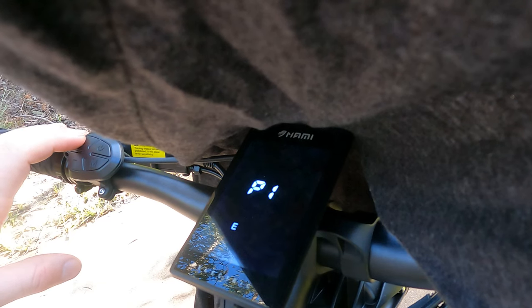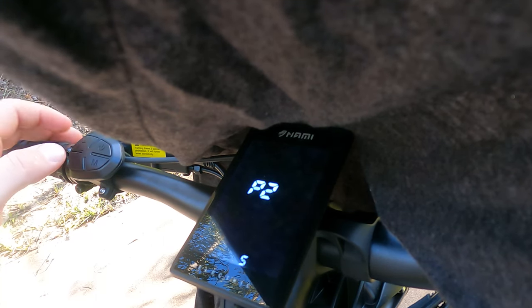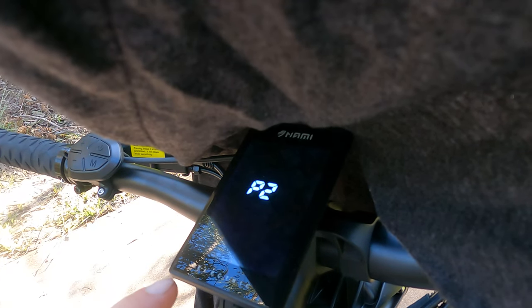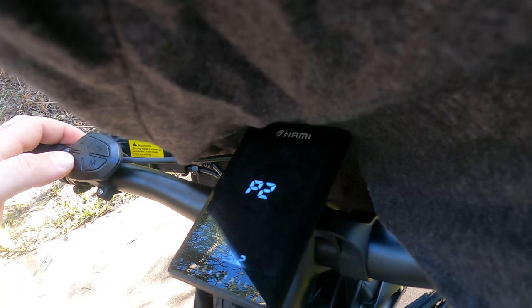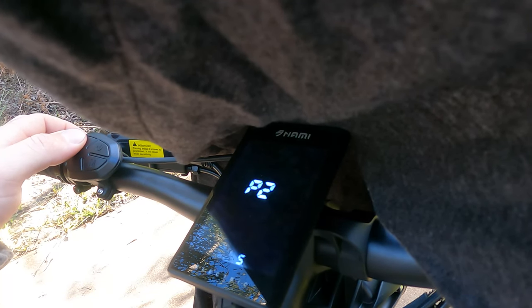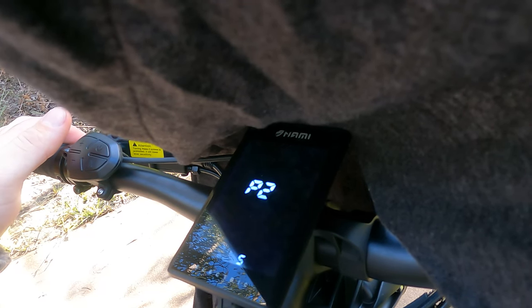What we want to do is click up to P2. P2 is your dashboard brightness area. 5 is the brightest, so if we actually go into that and just press mode — that bottom light is now flashing at 5. If we minus that you'll see the screen brightness will get dull. For me I like mine at 5, so we just click M and that's now saved.